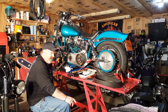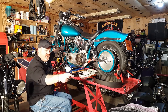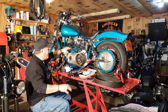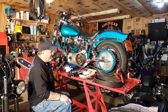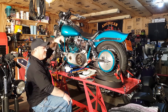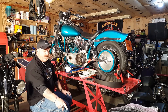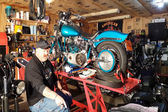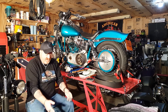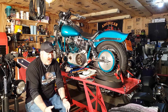The frame surviving was the biggest surprise of the whole build. I don't know if anybody knows what a grid box is, but it's basically setting out measured squares on a concrete floor, putting the frame on milk crates, shimming it with levels, making sure the whole frame is absolutely level. Then you take a rod with washers and drop it down through the center of the neck to see if it goes one way or another — checking if it's dead center.